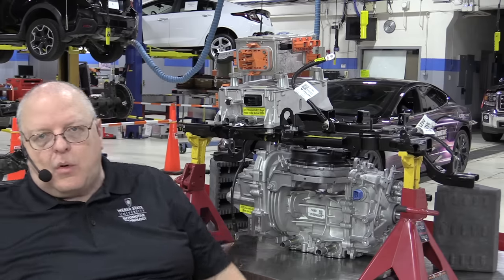Under the car we only have two electrical connectors: the great big one is for feeding power to the Power Inverter Module and for regenerative braking power back to the battery as you drive. This is also the electrical connector used when you connect up the DC fast charge connector to the vehicle — it charges directly through this large electrical connector. The smaller one is only for when you plug in your J1772 charge connector; the other is the CCS combo connector. We've got another high voltage electrical harness on this end — these two electrical connectors connect to our High Power Distribution Module on the two empty electrical connectors.